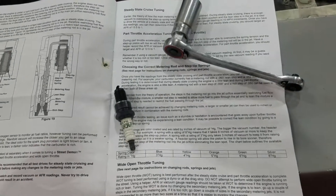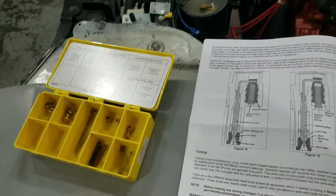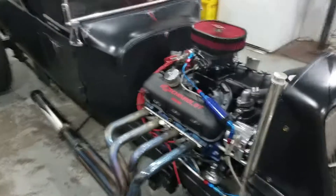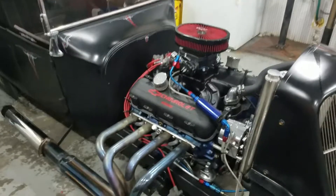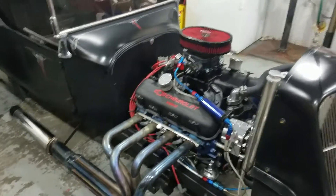So I got into the instructions — yes, Jerry Green reading instructions, I know that's hard to believe. They're telling me that the power valve opens if you've got a competitive camshaft in it. This does have a hydraulic roller cam that's fairly big, but I hooked up a very good vacuum gauge and had about 12 inches. They said if you're over 10 inches it shouldn't be a problem, but obviously we have a problem.